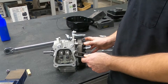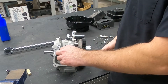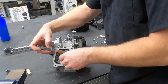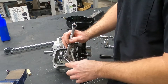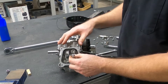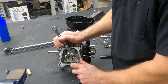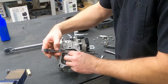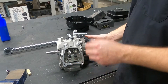Now I'm going to continue rotating the engine backwards. Watch the intake valve close. The exhaust valve will start to open, and while the exhaust valve is wide open, we will now set the intake valve. Same process. The other one, when I adjusted it, did not change drastically from tight to loose — this one did. That is very possibly something to do with the fact that it's been used and abused. So we'll back it off a little bit extra, lock it down. It's still got play in it this time. That seems probably a touch on the loose side, but pretty dang good, so we're going to go ahead and leave it there.